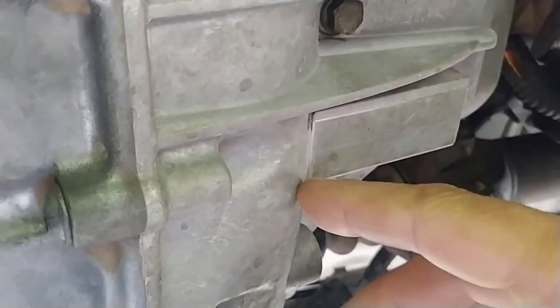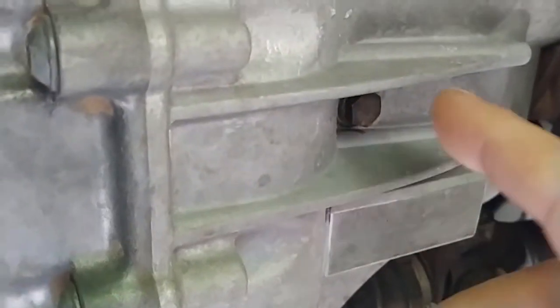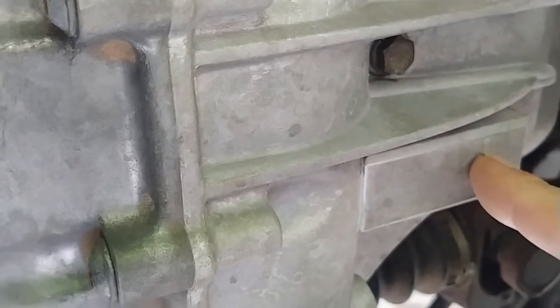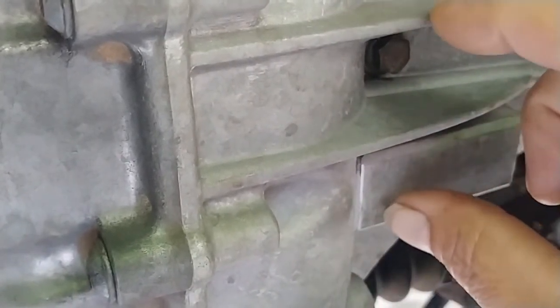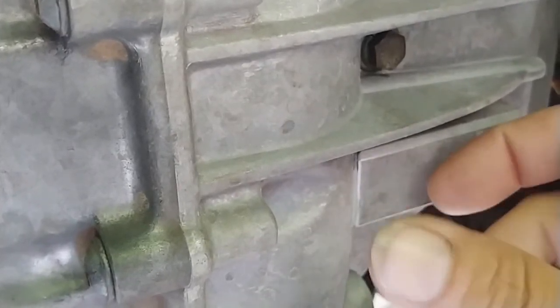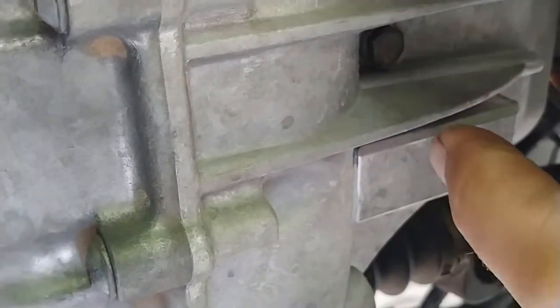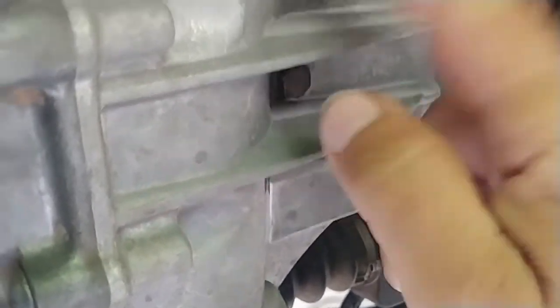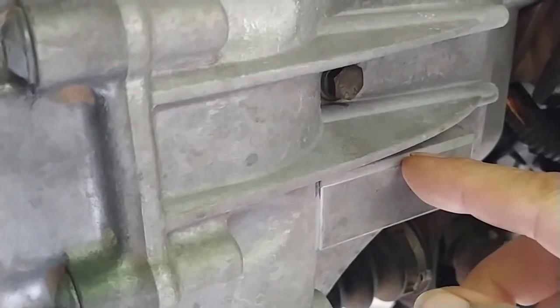So I had to make all this, and I bolted it to the case, and you can see there's a bolt here because there's two parts to this. There's another one just like this on the inside of the case that's laying this way, traversing this to give support to the plunger so it doesn't rock over as that gear selector is turning by the electric motor right there. So there were some modifications I had to do to this case to get it to work.